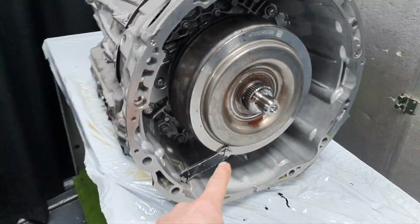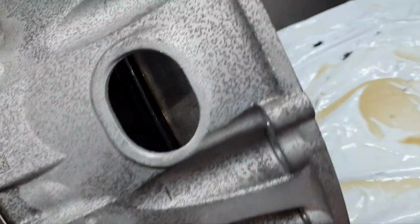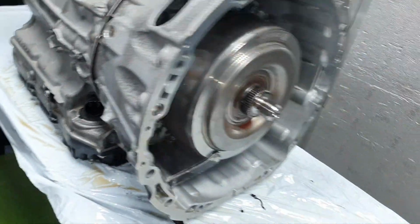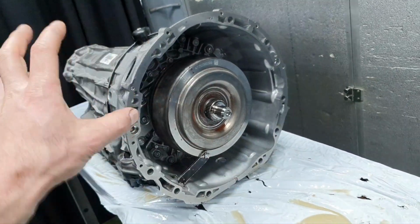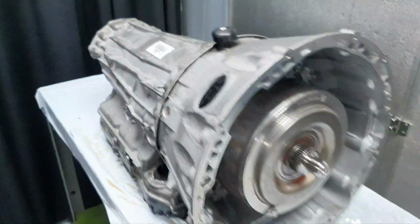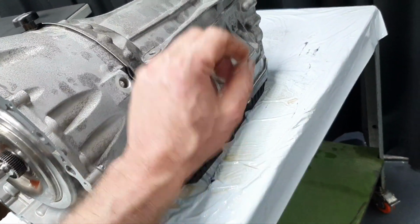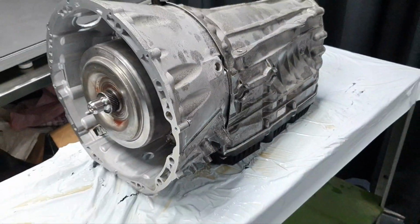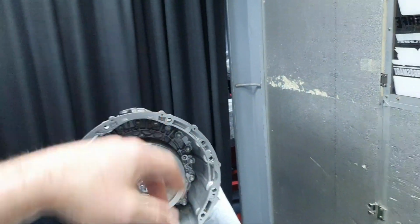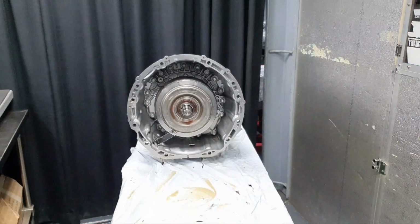1 minute only. And that's it. Bracket in place, don't fall off. All right. Seal back in place. Bolts been torqued down. Going outside of the engine room, they're gonna block the oil lines here so nothing falls inside. They're gonna take care of the transmission, clean it to be beautiful with brake cleaner, so there are no oil marks from my hands here and there. Wrapping it, and at the end, changing the transmission filter and putting fresh oil inside. And everybody happy. That's it for the transmission. Whenever I have space, because inside I have how many engines, I'll continue with the engine for this car to install pieces and connectors. That's it for now. Thank you.